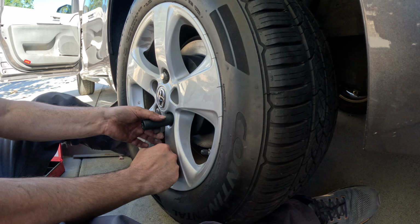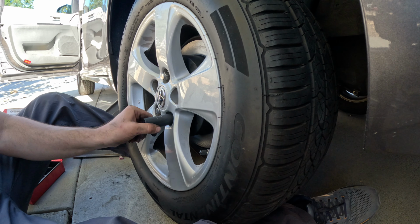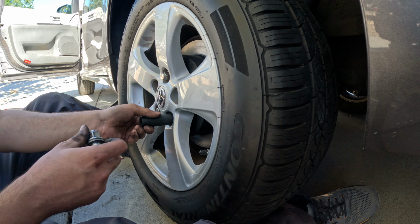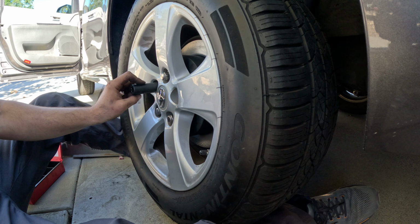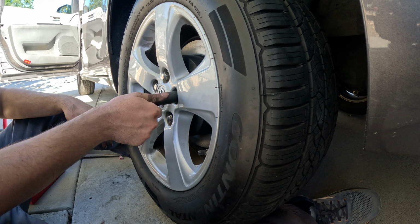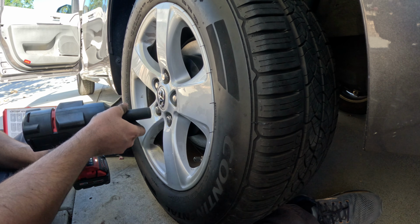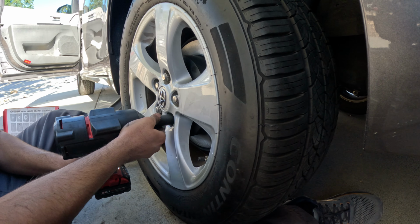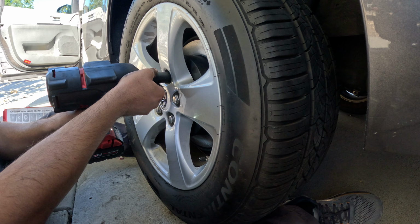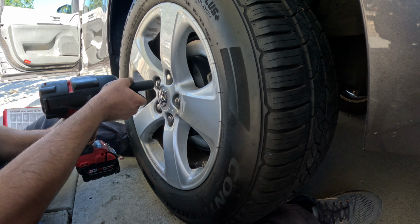I do them really lightly with my impact. You don't want to tighten these wheels with an impact. I just do it lightly, and then after I set the car back down, I'll get the torque wrench out, and I'll torque them to, I think the spec is 86 foot-pounds. I'll link it in the description too.